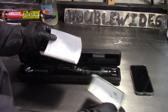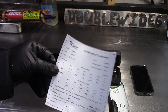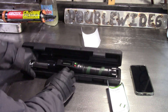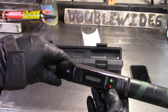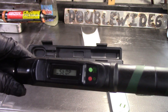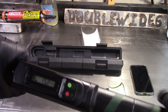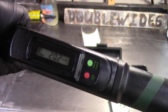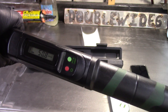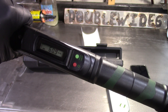E-torque also makes digital torque wrenches. All their tools come with a certification of calibration — the tool has been tested for quality control within three percent of what it's supposed to be. This is a battery-powered tool that takes watch batteries. It's in the stop or storage position. You pull out the handle just like the manual tool, and once the handle is pulled out you can rotate it. Right now there's 21 inch-pounds and as you turn the knob it's very nice and smooth. We're at 60 inch-pounds — click the handle in and it's all set.